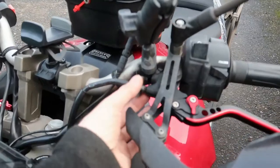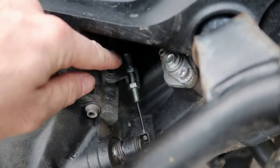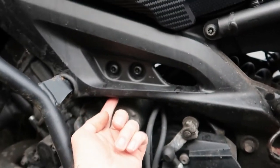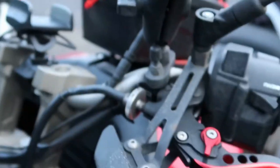What we're going to do is play with this little adjuster here and slacken all that off, and also slacken off down here. These two nuts here — the clutch cable goes out that direction through the engine, then it comes under here, the other side of this engine bolt behind this bit of frame, and then up underneath. Then it passes here — see that, that's the cable right here. I'm not sure if I need to undo this mounting point, but then it goes up to the side of the fork there to the bar.